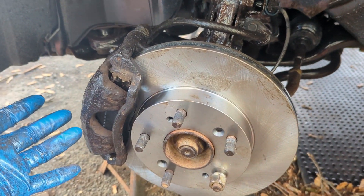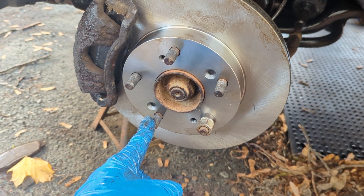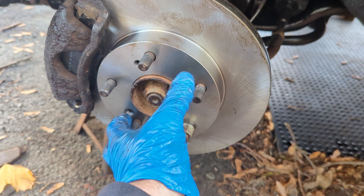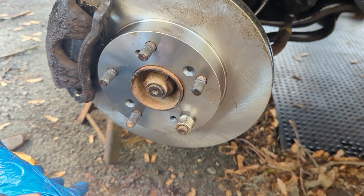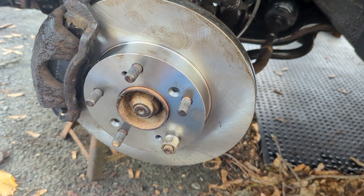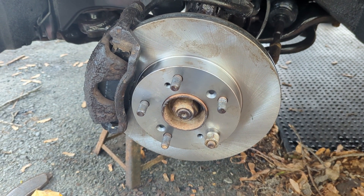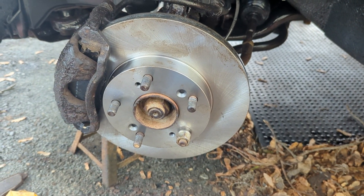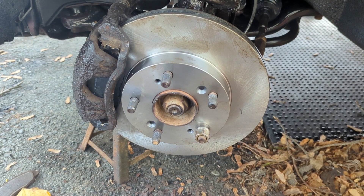I got my caliper back on — only two bolts, easy job. The mechanic gave me a good tip: the main reason for these screws is just to hold everything in place so the rotor isn't flopping around while you're putting your caliper on. He said just put on one lug nut so nothing moves, and then once everything's bolted the rotor is held on with the wheel nuts. I'm gonna do the other side now — drill those out, forget they ever existed, clean this up, wipe it down, put the wheel back on and call this good. Okay, onto Civic brakes — thanks for watching.